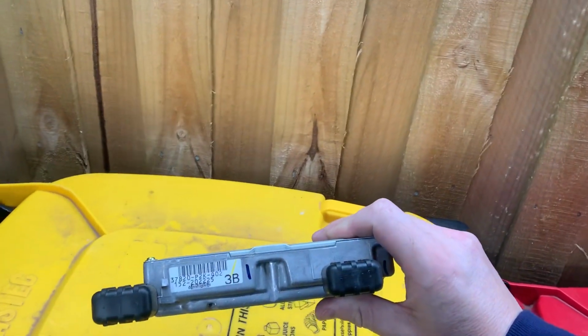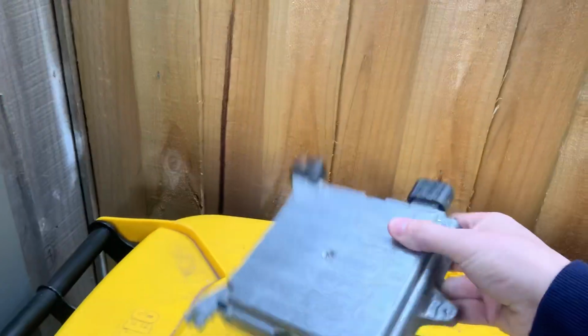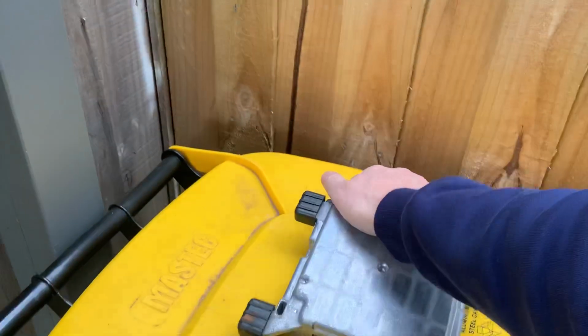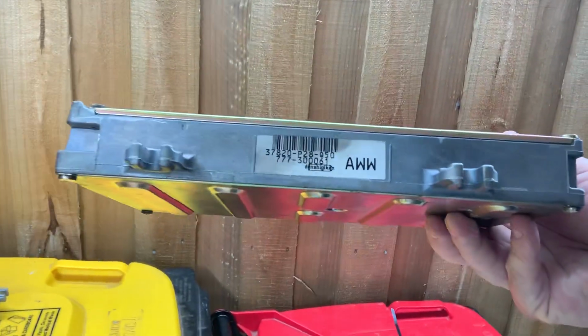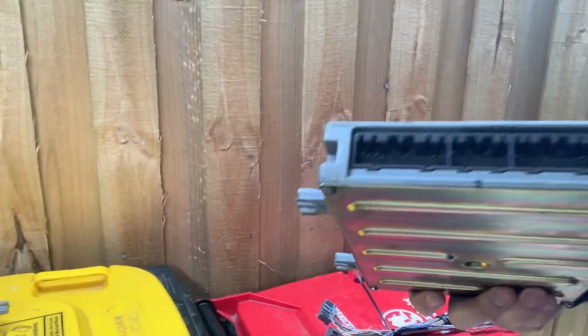But here's the ECUs, and again, apologies for the shaky video. I'm looking at the camera, which is over there, but my face is over here, so it's a bit weird. Now this is the standard ECU from the EK Civic. It's a P2K. There are 2 plugs here, and this is a piece of loom, so that goes one in there and one in there. I also managed to get, in the very first car I looked at, a P28 ECU, which is the holy grail, with the 3 plugs.